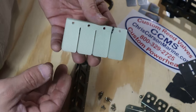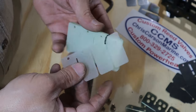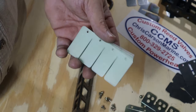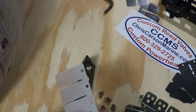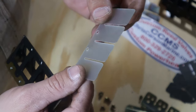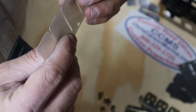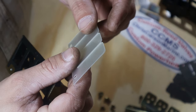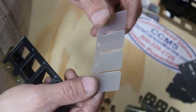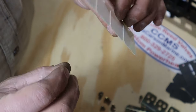What you want to do is install one at a time. As you take apart your reed assembly, install your composite reeds right away. Don't go mixing parts up, misplacing things, or being careless — these are high performance parts and they require careful handling when installing. First thing I'm going to do is inspect this reed, check for any sharp leading edges, and make sure everything is nice and smooth before I install. I don't want any burrs or sharp edges. These are made extremely well — they look laser cut, and it doesn't get any more precise than that.